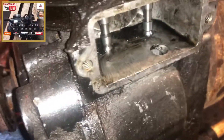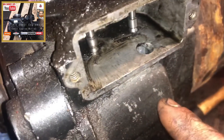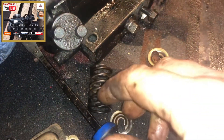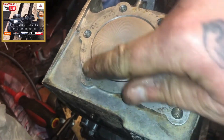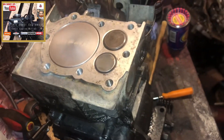In order to access the valves we have to remove — which I've already took the liberty of doing — this cover here, which acts as a crankcase breather. You can see the hole there which acts as your breather for the combustion chamber. You've got your two valve stems there — your exhaust and your intake valves — which are held in place by the springs and these valve keepers or valve retainers. I've already took the liberty of removing these, and also cleaning up around the head where the head gasket sits — piston, intake, exhaust valve. So we'll now have a look at lapping these valves.